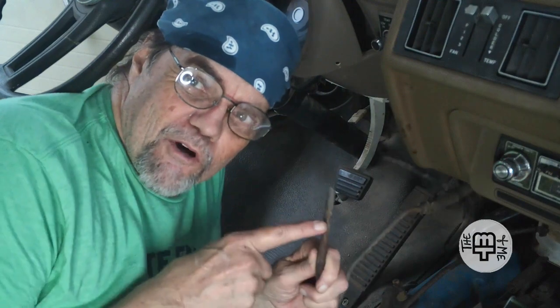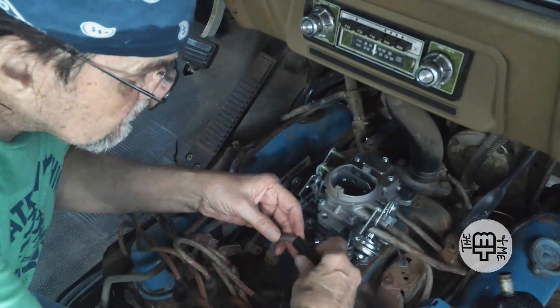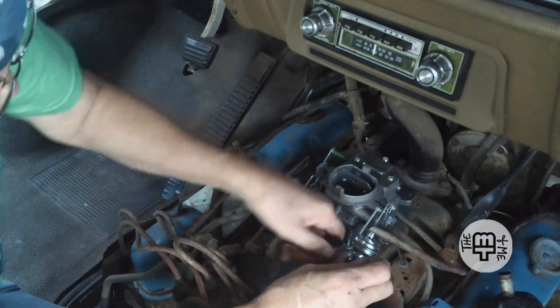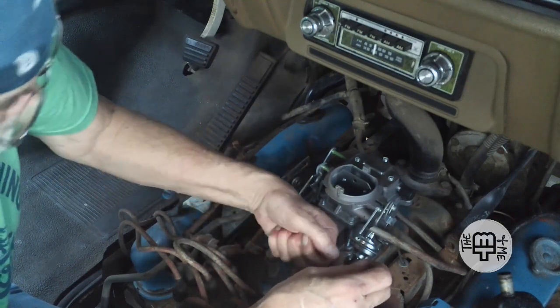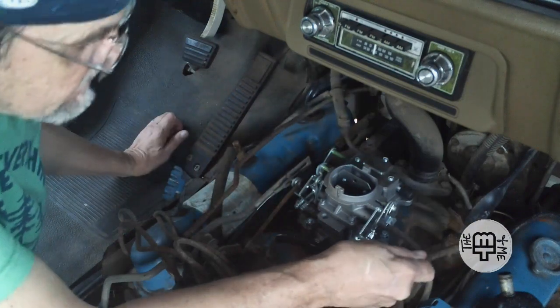Now let's see if we can find a piece of vacuum hose that'll fit snugly over this line and connect these two pieces. Well, I'm betting that the half-inch hose I have is going to be a little big. So I've taken 3 inches of this, which I think is probably a 3/8 approximately on the inside diameter. See, it's nice and clean. I can see all the way through it. Anyway, let's see if this will fit on this tubing. Make a connection. Oh yeah, good snug fit. Oh, we're perfect. And we'll be able to put this in. And we'll get our connection back.